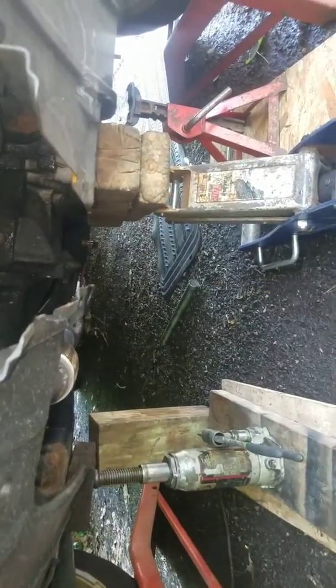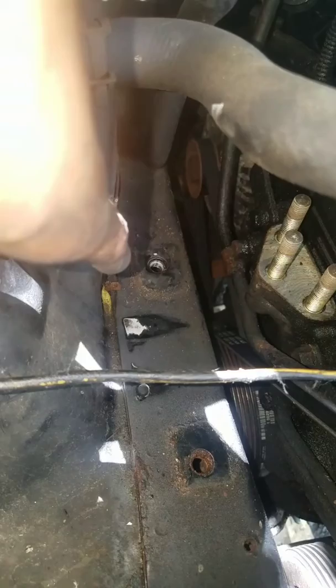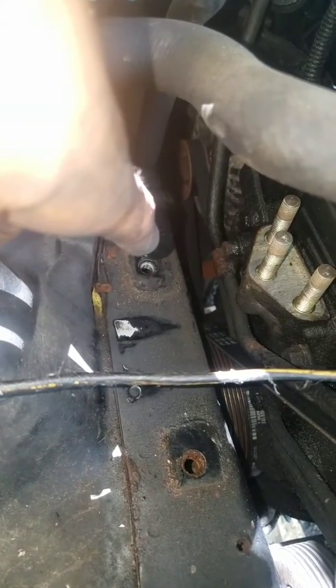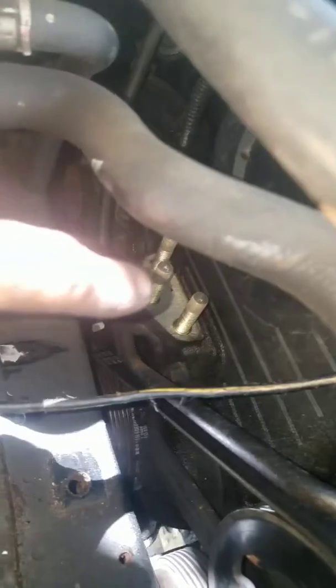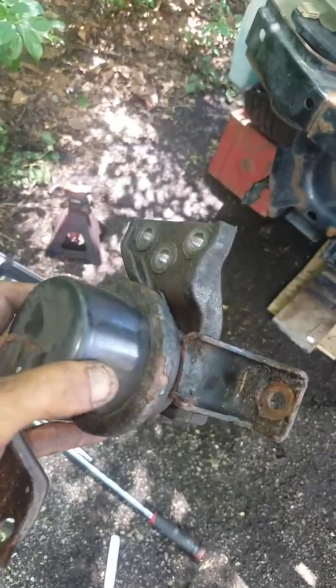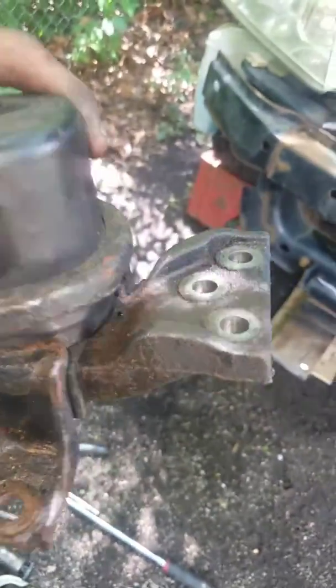So far, I had to put a jack on each side of the motor. It's really hard to just jack it from one spot. If you're trying to remove your passenger side top mount, it's just three bolts. You have to remove those three — they're 12mm. These three over here are 14mm. Then you have to jack the motor up a little bit on the passenger side and it all comes out like this. There is a nut, a screw holding this bracket.